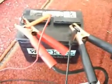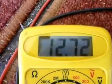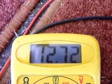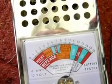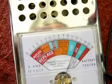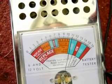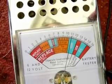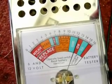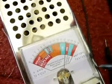Okay, here are my two batteries. I've spent a couple of weeks working on them, using the battery charger and some Epsom salt. Starting with this one — it was the one that was a little over 4 volts, and it's now showing 12.72 volts. I've got the load tester hooked up to it, and the needle is above the 'good' mark. We're going to run the load test for about 10 seconds. And after 10 seconds, it shows it's back to good. So good things have happened with that battery.